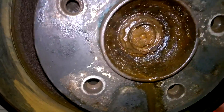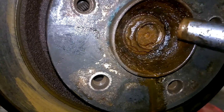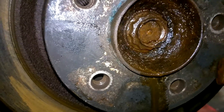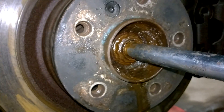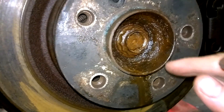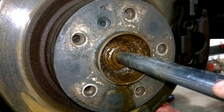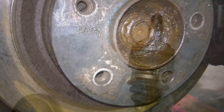I put the nut back on — make sure you don't put it on so far that there's no room for movement when it starts to go. I used a punch along with plenty of lubrication around the shaft before putting the nut back on, then used a punch and a dead blow hammer. That has started to move, and I now have the shaft out.